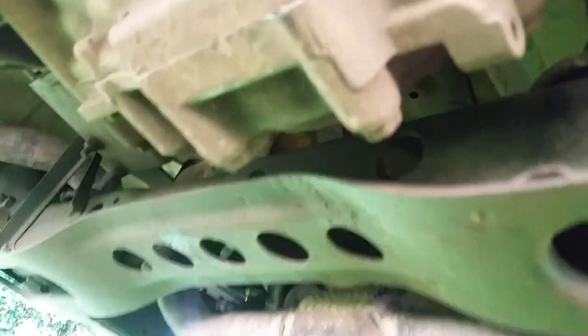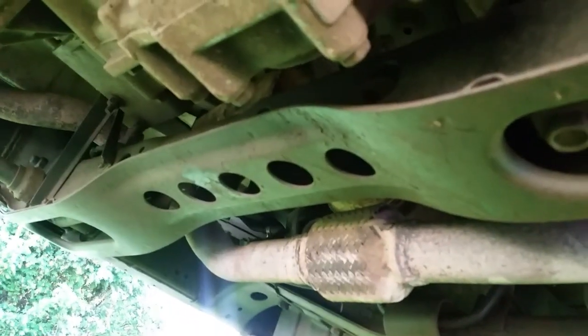I should probably be able to pull that straight down, but the downside of this side is it has a very long pipe that goes back and bolts right there. The reason I bring that up is here's your transmission mount. Somehow if I can push it up and push it back down, I can get it past this. One thing I'm going to have to do is pull this center bracket out. I did take a piece of 2x4 — I put it between the transfer case and the main bracket there, the transmission mount.